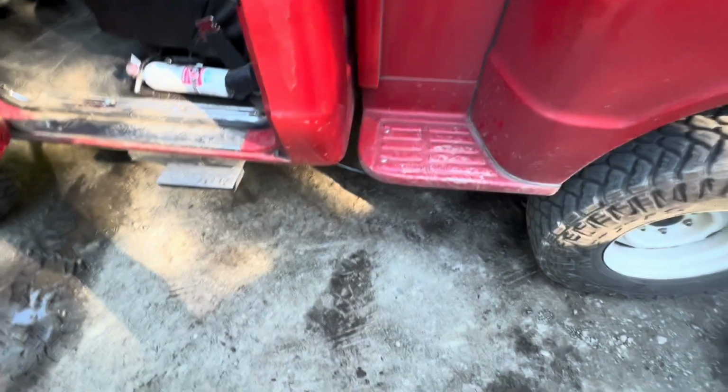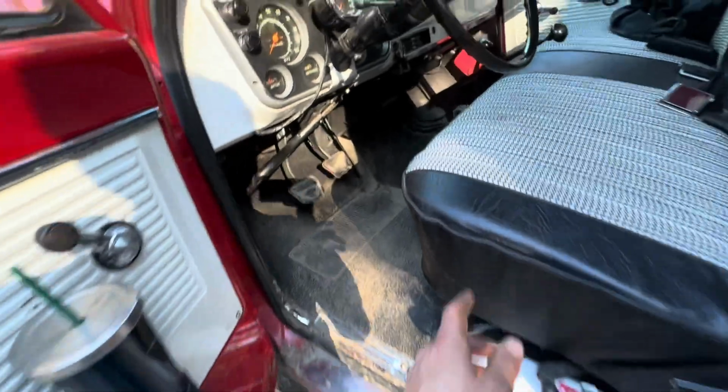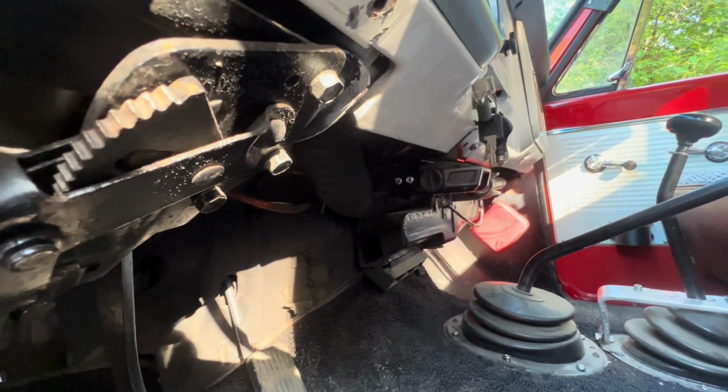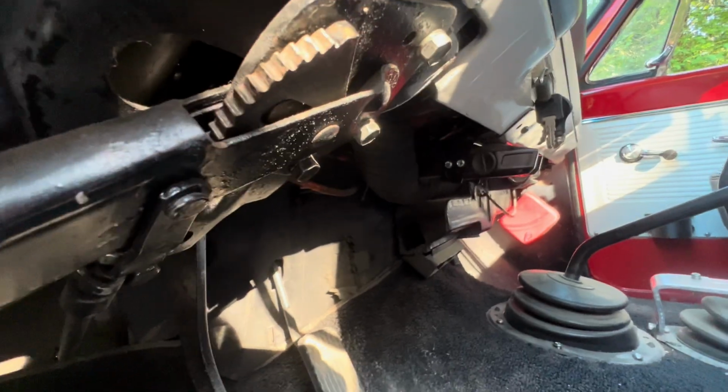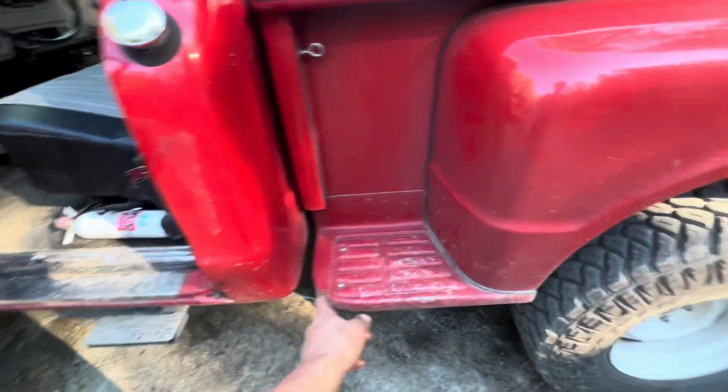Now this right here, I was in a pinch one day and I needed trailer brakes. So first I sketchily mounted this into the truck, but I built a custom bracket for my trailer brake. Holds it right there, really nice. You can see it's just a piece of like 14 gauge steel bent, and then on the top where it mounts. But I just ran the trailer wiring.